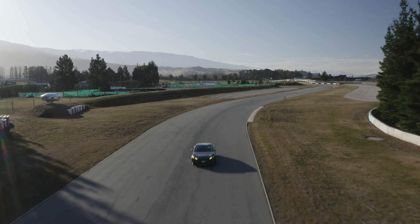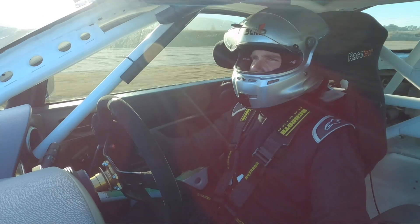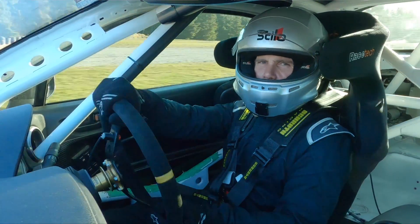We're back at the workshop after a pretty successful run at the racetrack. The car felt relatively balanced, but we did note a little lack of driver confidence through the fast left-hand Turn 1. We've got the car onto our corner weight scales for an initial reading, and what we can see is that our cross weight percentage isn't quite where we'd be aiming for. For a circuit or road racing car where we want equal left-right handling, we're generally shooting for at least 50% cross weight as a starting point. We're not quite there, so we're going to make some changes and see if we can get an improvement.